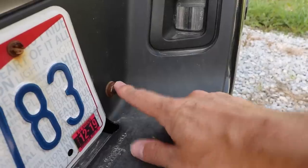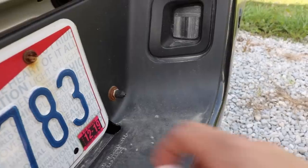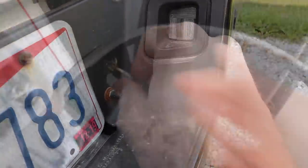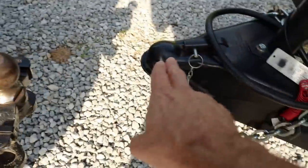Here's the valve for my airbags. I had these installed by the Chrysler dealer and it only cost me $175. They wound the lines right up there, and I inflate mine to 30 PSI before I put the weight of the tongue on the ball. The air springs helped quite a lot with the squat and ride quality, so I would definitely recommend getting something to support that extra weight being pushed down on the bed of your truck.